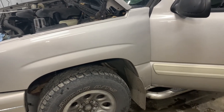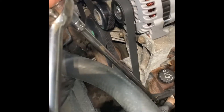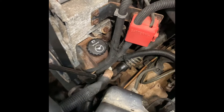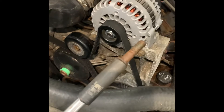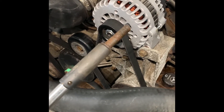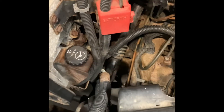I got an 11 millimeter on a 16 or 18 inch extension and it's able to squeeze right in there between those power steering hoses, and we're able to get that bolt right out of there. It was a little tight but I had put a little PB Blaster on this pretty liberally the other day so I think it soaked in and helped me out a little bit.